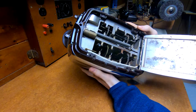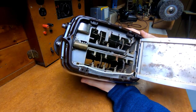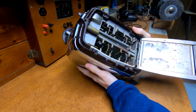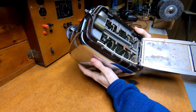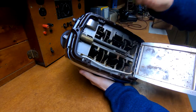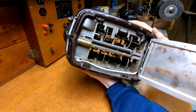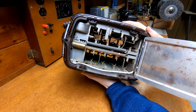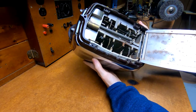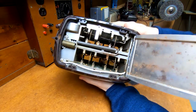I always had this idea in my head that toasters need to have a chime, and I was kind of hoping this would have some sort of a 'ding' when it reaches the top. The insulation on that wire there looks pretty good - I think it's using mica sheets for the wire. I get the distinct feeling that if this wire still has good continuity, it's going to reek when it actually warms up. The cord's actually in pretty good condition.